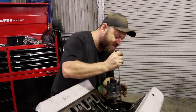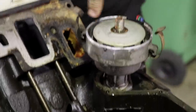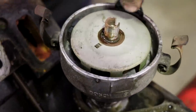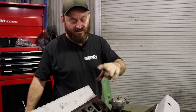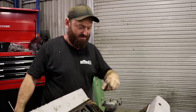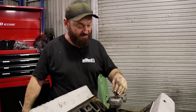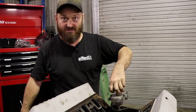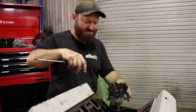Let's have a look inside this distributor. You can't really see much, but it's actually got an external 8-pole hall sensor. And then inside it there's another hall sensor that splits the cycle. These were the only ones of the 304 injected engines that were sequential - previously they were just batch fired, where the injectors were grouped and the dizzy did the rest. An emissions thing, I would imagine. But we'll use it with our fresh ECU.